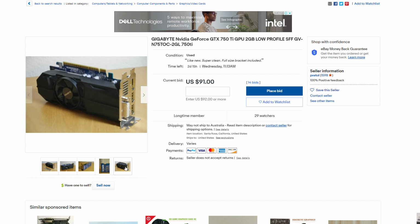Even though the GPU temperatures did creep up a little bit, they were still well within the range of being fine for everyday gaming. And even if they went over 80 degrees, we could still just take the side panel off and put an extra fan on this thing if we needed to. However, the best thing was the FPS. When it came to loading up GTA 5, even though it was 1080p normal settings, it still played the game at over 100 FPS, and it had smooth 0.1% and 1% lows.